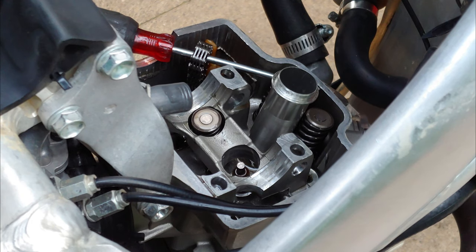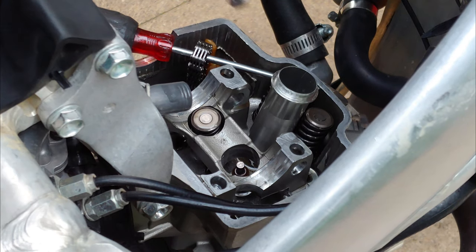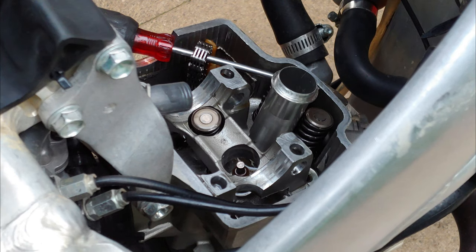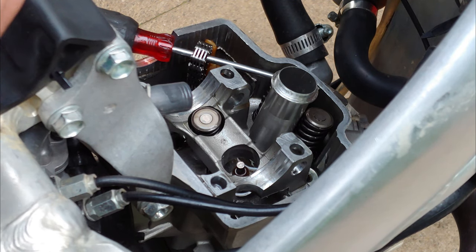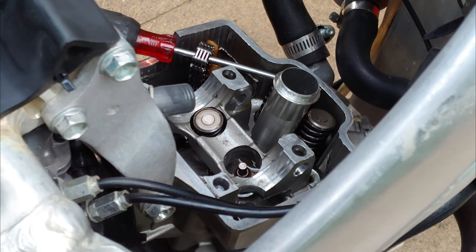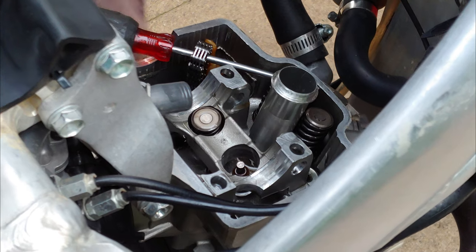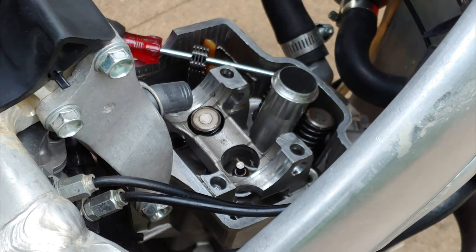It's funny because I had a feeling that's what happened, because this is what happened to my other bike - a 2007. When I pulled it apart, the left side intake valve stem broke off at the keeper valley and ended up jacking up that way. One of the lifters was cracked in the middle, so I got a new lifter. One of the springs was missing a coil.